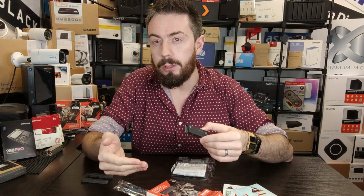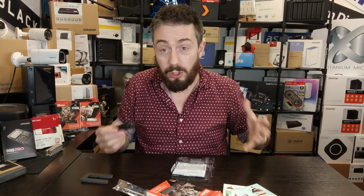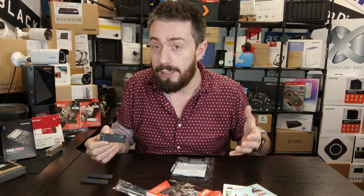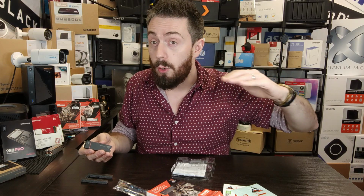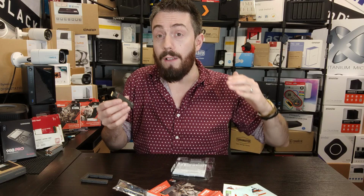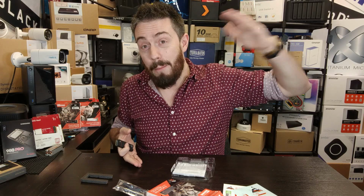You don't have to be a user that's going to be doing a lot of writing. You want to know that SSD, which again is not as durable as traditional boring hard drives, is faster, and that's good to see. Although there are a lot of SSDs in the PCIe Gen 4x4 bracket that have 0.7 or 1 drive writes per day, almost all of those are using either Phison E16 controllers or effectively the previous gen controllers, so they don't give you the speed. That's why you see a lot of drives with a lower drive writes per day, because they've increased the speed, but that just means it's going to wear away at that NAND quicker.